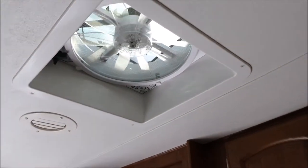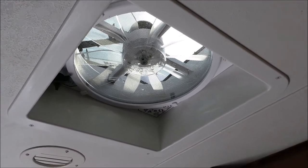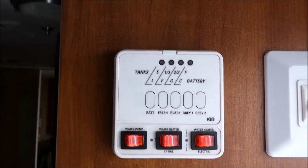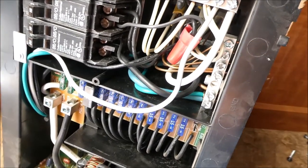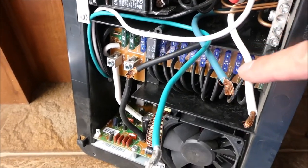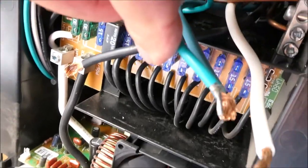Now we can commence the electrical work. I know the battery power is off because it's boiling hot in this trailer and I had this fan on and now it's off. I'm not going to be able to videotape all this, but the sequence of events is: this clamp needs to be undone, and the black, white, and green wires need to be undone from in here. Here are the three wires disconnected: white, green, black. The green was paired up with another green.